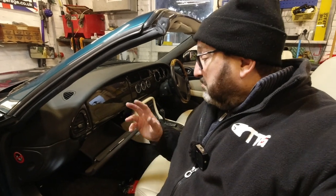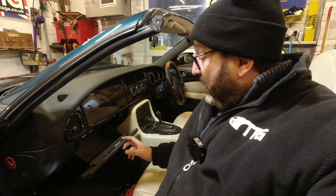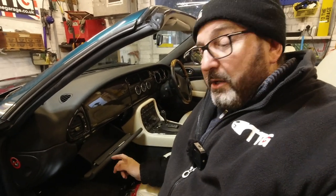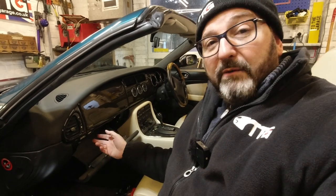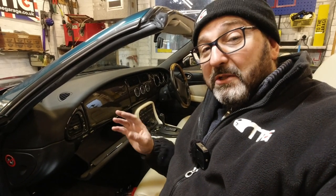For ease of talking this through and demonstrating it — it's very hard to film everything in here — I could fix my handle in situ but I'm not going to, because I want to give you better pictures. So what I'm going to do is remove the glove box door, and that is done by removing four screws from the underside that hold the hinges into position. They should be Torx T30s, however I know mine's got a selection of bolts, which is something I'll sort out whilst I'm doing this video.